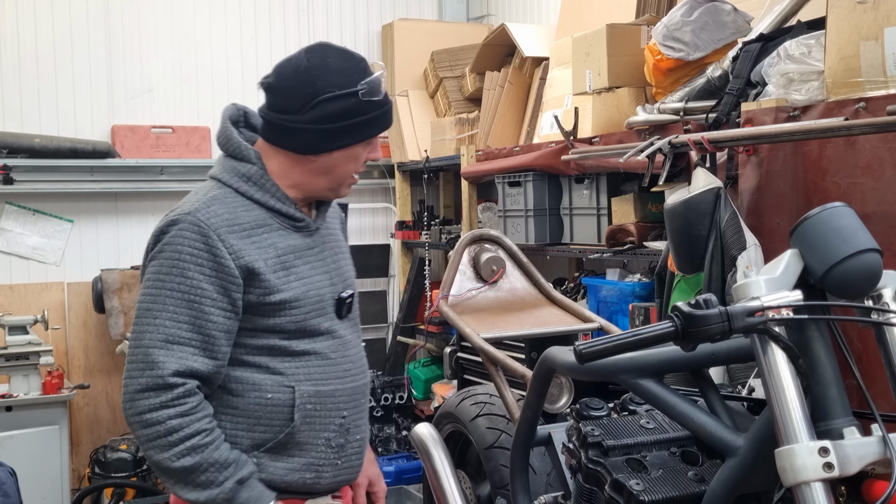Don't like doing it this way. I need some thinner card. Because this has got to fit up really nicely underneath it, which this ain't going to. It needs to be a little bit less. We could do it on the top, I suppose, but ideally, what I want to be able to do is put a piece of thin card on, and then rub it with a bit of alley so I get an outline. That will give me the top side of this tube, and then we're stepping it in very slightly, just such that when the sheet metal is placed on it, it's flush across the top, so you get the top of the tube, and then the sheet, and then the other top of the tube, and it's all in one line. This stuff ain't gonna do.